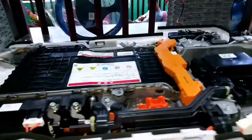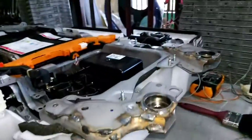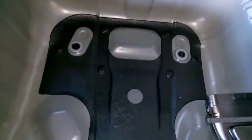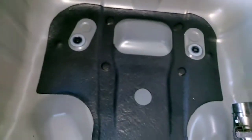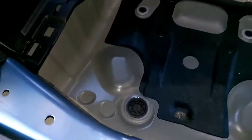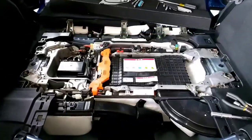The battery is completely assembled. We already cleaned out the debris — including some material we found inside this cover underneath. Everything is assembled; as you can see, it's a plastic enclosure completely insulated from the chassis and ready to install back in the vehicle. I was blowing out the compartment with high pressure air to make sure it's clean, since the fan absorbs everything from in here. It was a little dusty due to the condition of the blades, but it's good to go.